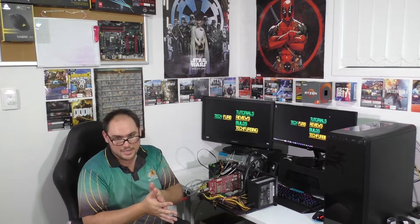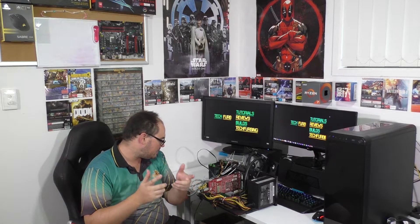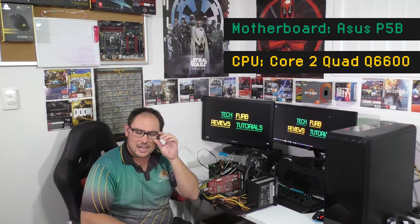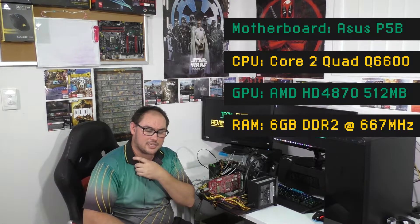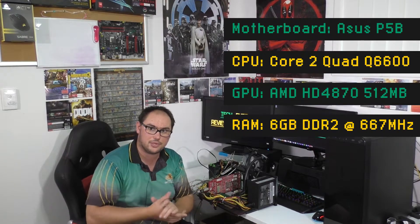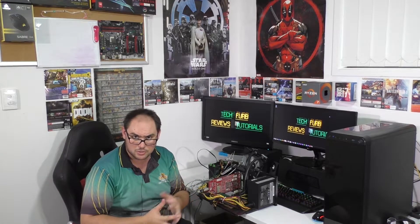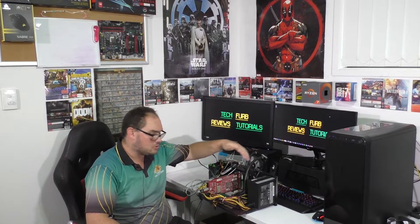Let me run over the specs. We have an old ASUS board — it's a P965 chipset. That's pre-me, so I don't actually know that generation of hardware quite well; it's just a fraction before when I got into IT. The processor I know quite well — it's quad core, pretty much the first mainstream quad core. I've overclocked it to 3 gigahertz, and I've got the Corsair H60 water cooler sitting on it purely because it's on the test bench and it's just easier to slap that on than track down a cooler for this CPU.